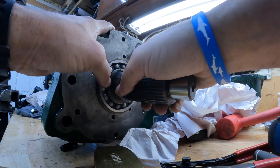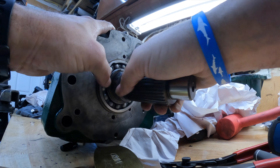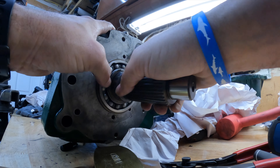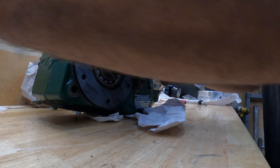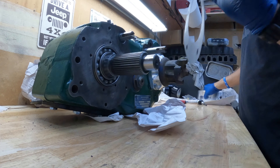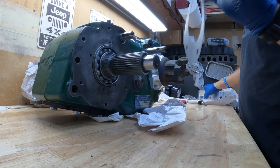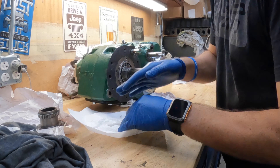It's been about a week — I had to film a couple other things and needed some confirmation on a few things. So let's finish this thing out. We've got the new shaft that we just put in completely sealed. I'm going to take a gasket, lightly skim it with some flexible Permatex, and put it on there. We will not be reusing the bearing retainer as confirmed by Northwest Fab — those holes are left open for drainage. But on the back of this housing it's all machined to keep the fluid in this area to lube up the bearing but also keep it from spewing through the seal.